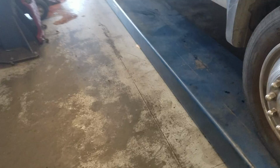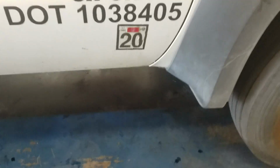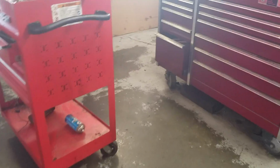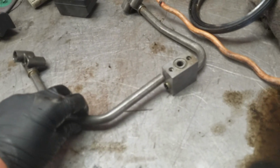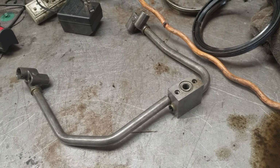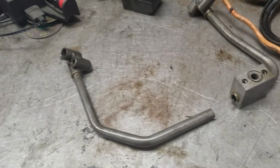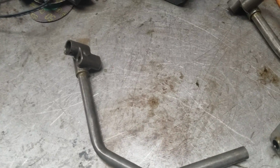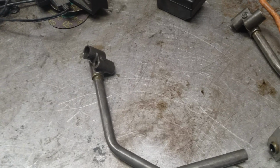You do got to remove the transmission and the rear cover to get to the stem pipe. Excuse me, the branch tube. So I did that earlier. I was trying to make a video earlier, but I thought this would be a little bit easier for me. It's very hard to do that. So yeah, branch tube, steel. I think because the leg is longer, and I found out the Torx, 27 Torx was loose. That probably contributed to the leak or it cracking.